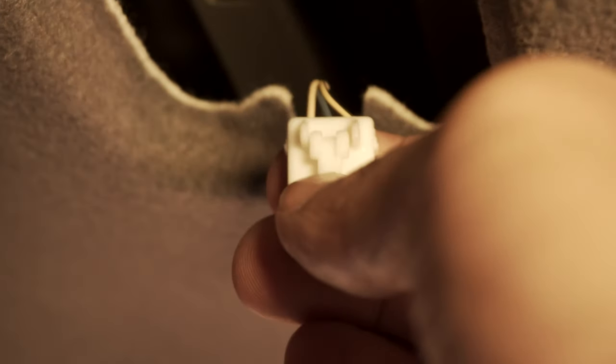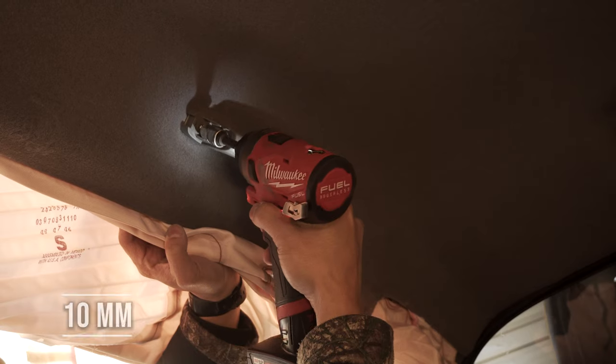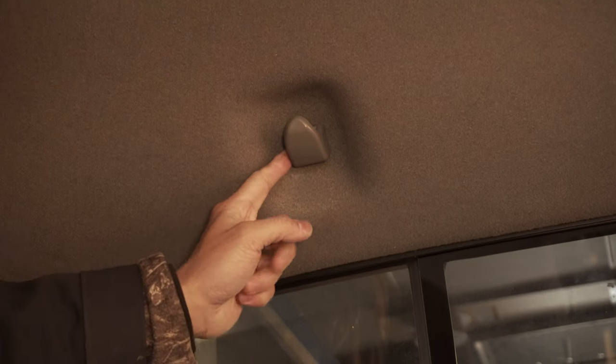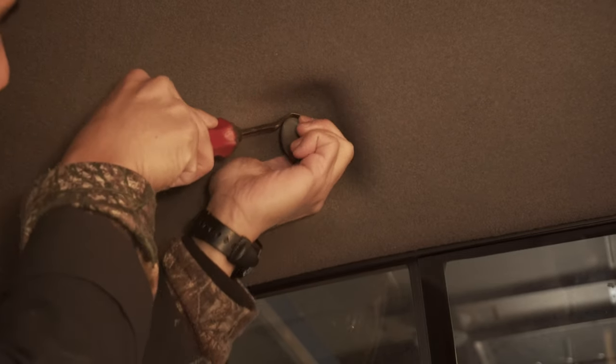There's a little tab you have to press down on top and it pushes right out. Now we can remove this rear grab handle. The forward cover ended up breaking off a while ago — all you had to do was jam a screwdriver in there and pry it off like a clamp. We'll use a 10 millimeter socket to remove those screws. For the little hanger, it's the same thing — turn it 90 degrees. It might be locked up so use a pry tool to push against the top, unlock it, and rotate it 90 degrees and it slides right off.